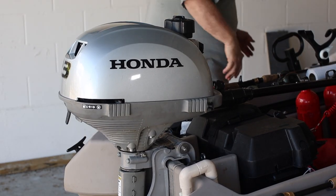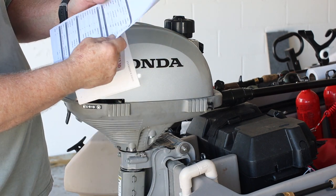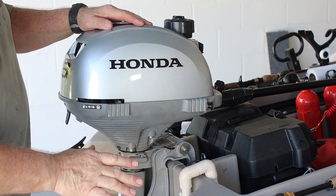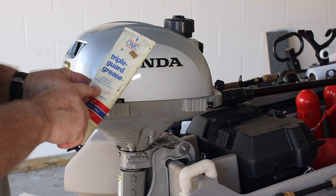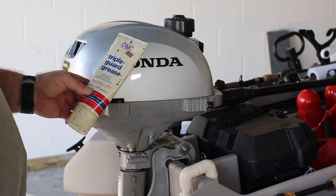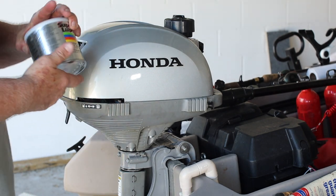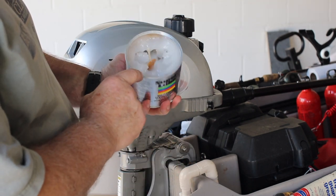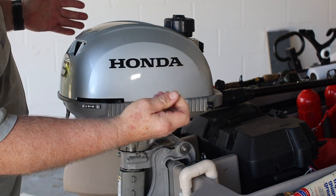What's one of the most important things that you need for working on this? That's the manual — it gives you all your specifications on the motor. I printed this so that I try to keep this from getting all dirty. In addition to that, you need lubricant, some kind of grease. The manual actually calls for a marine grease — waterproof, anti-corrosion, an excellent lubricant made for boat motors. However, this is black like regular greases and gets all over everything. Where I can use it, I'm going to use this — it's called Super Lube. It is a synthetic grease, extremely lubricating, does not rub off, and is waterproof. In addition, this is a food grade lubricant — you could eat this. It's clear so it doesn't get all over everything.